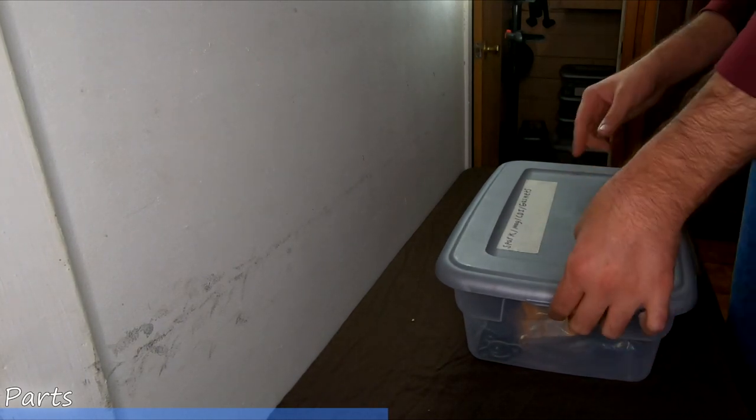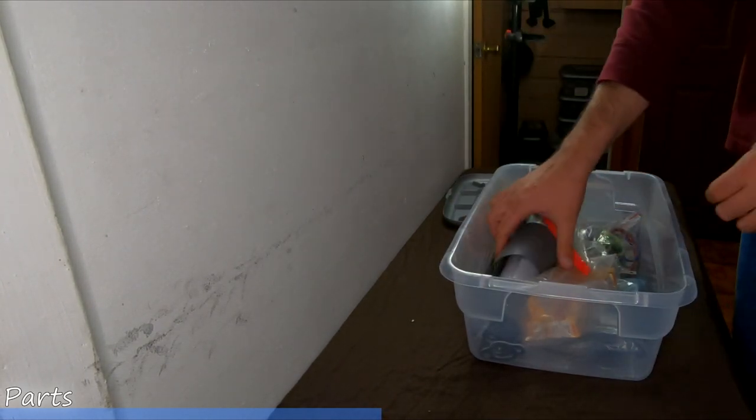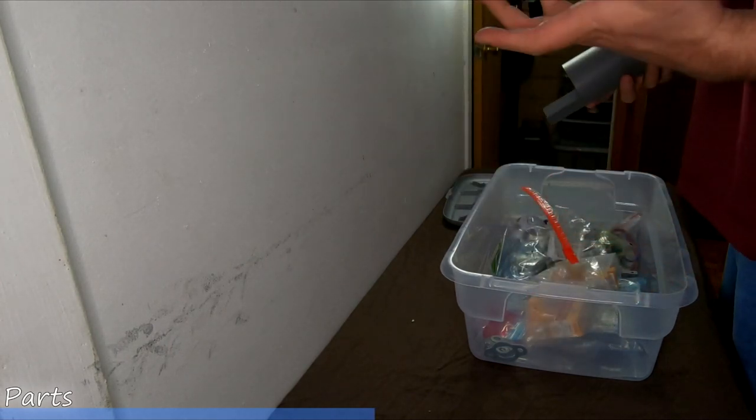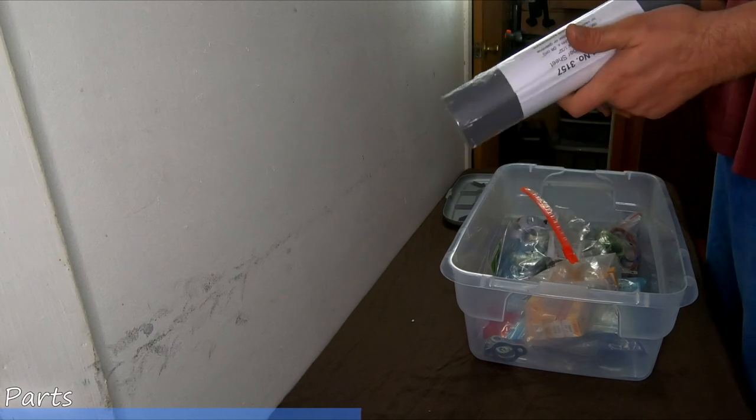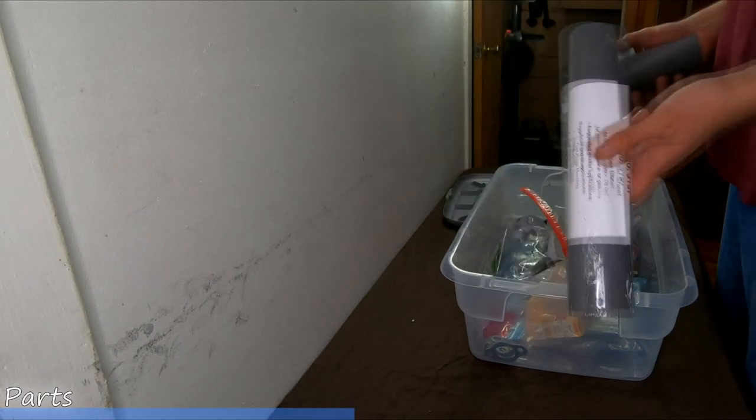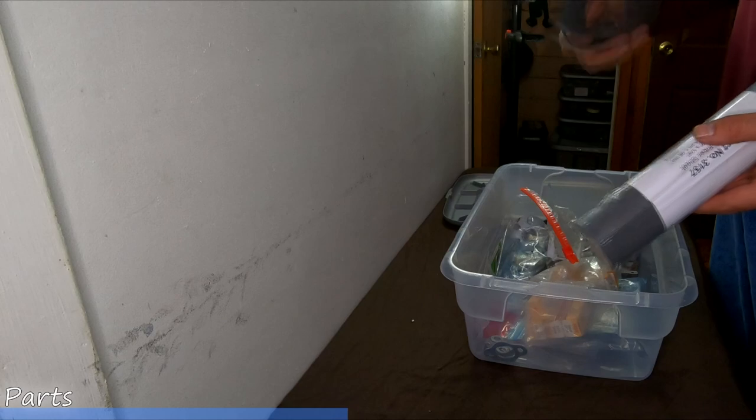Spark plugs, mags, CDIs, gaskets. Basic Felpro gasket material. It's resistant to water, oil, and fuel. It's what I use for my intake gaskets, my crankcase gaskets, base gaskets. It's about a millimeter thick.